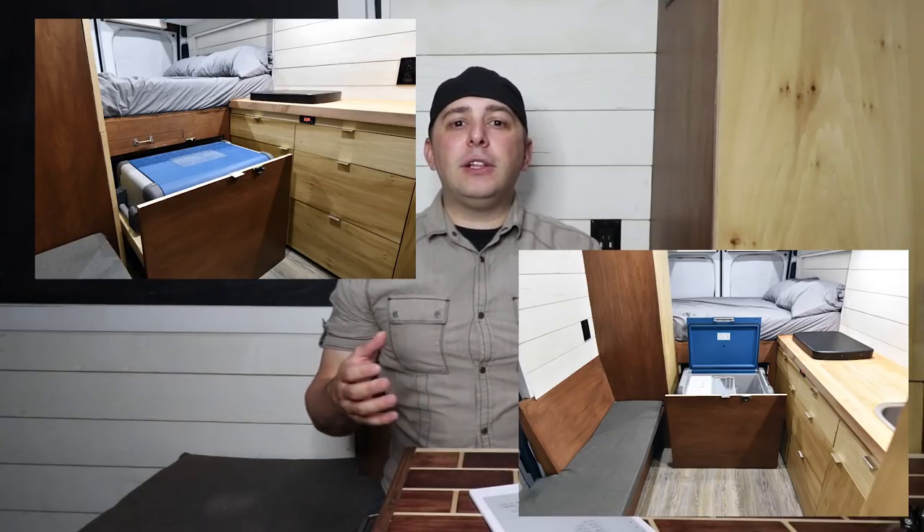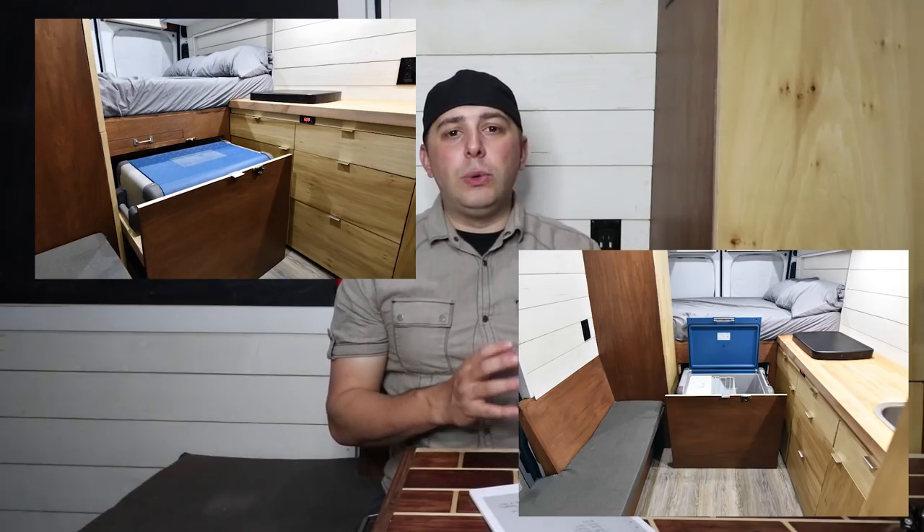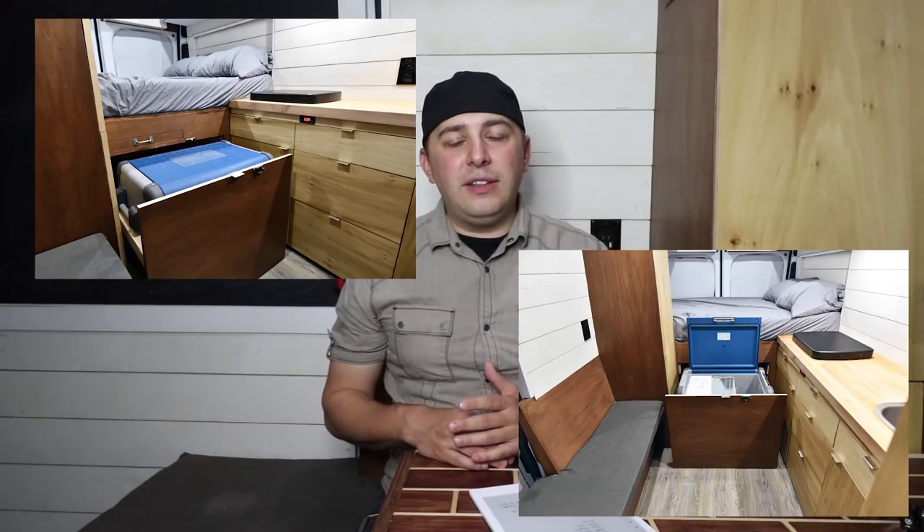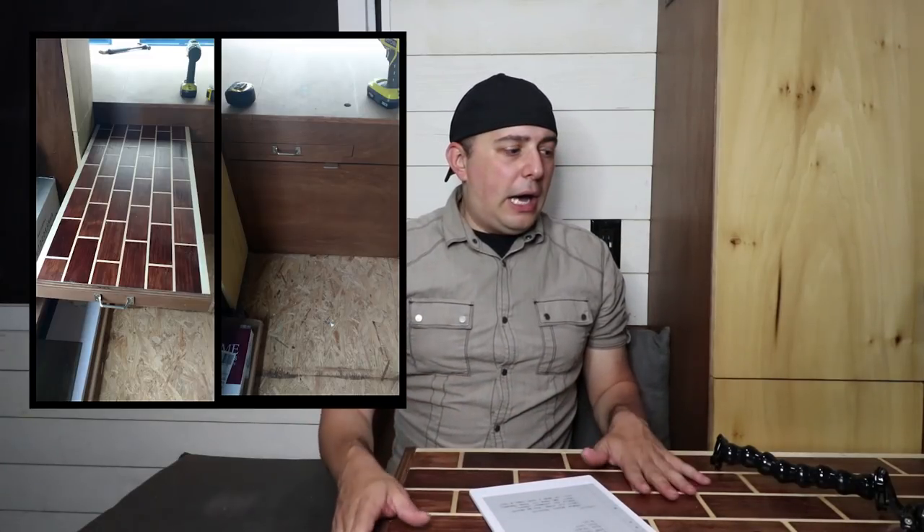The propane will kick in if you have no power to run your refrigerator, but you need to vent the propane. So he had to cut holes in the side of his van to vent out that air just in case the propane kicks on. That's something I didn't want to do because I wanted to stay stealth. I went with a Dometic fridge that can run off DC power, and I wanted a fridge-freezer combo. Unfortunately it is open from the top, but I made it work — I slid it out and saw different vans that did it that way and liked how they did it. I may change my fridge in the future.